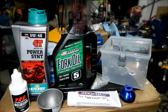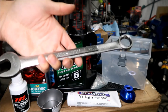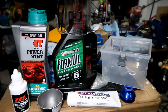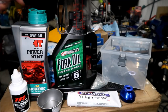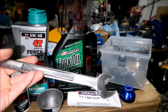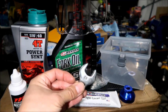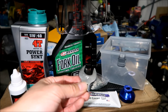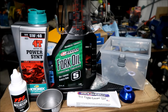Some other tools are just common garage tools. You're going to need a 22-millimeter wrench, a 12, and a 13, plus whatever you need to remove the fork from your bike. The oddest one is the 22-millimeter - it's a fairly big wrench. They also say you need a 22-millimeter crow's foot to torque the compression rod. I only had a 19-millimeter crow's foot so I just snugged it - the torque spec was very low so I said whatever.